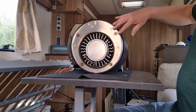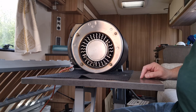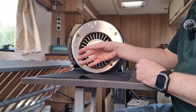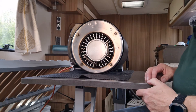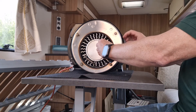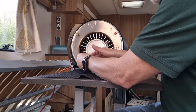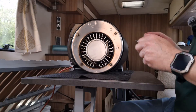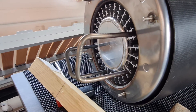Having taken off the rear panel, that exposes the ends of these two elements that run all the way through the middle of the unit. It's now a case of easing those out, pulling them out this side, and then putting the new ones in. That's the reason for having to remove the unit from the corner — we won't be able to get it out with them needing so much room to be pulled through. I've already seen from research that sometimes these rods get quite stiff and difficult to move and might require a little tap through — I can feel a bit of give in these but they're probably going to need a tap from the other end.